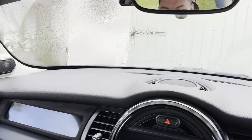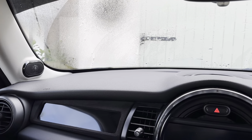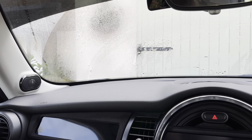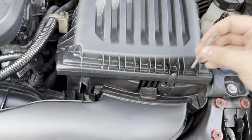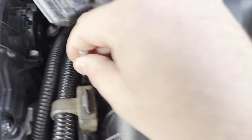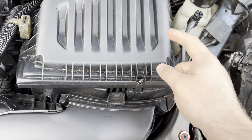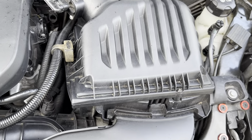What we're going to do is open the bonnet, get the old panel filter removed, and I'm going to clear the inside of the air filter box as well — just so when I've cleaned the air filter, I'm not going to be sucking dirt straight back into it. That's always a good idea. Then we'll get to cleaning the filter. You're going to want to take a Torx T25 bit — you've got one screw there, one screw down in here, and one screw there. You can also pull off the retaining rubber clip, and the top of the air box will pull out, giving us access to the panel filter.